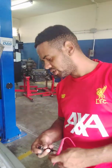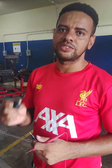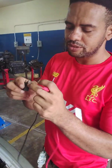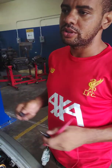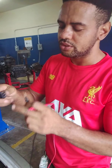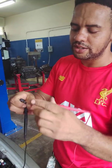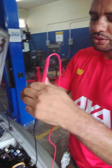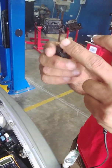All right. So now, this relay that I have in my hand, it is de-energized, meaning that the switch for pin 30 and 87 is not activated. With the switch not activated, when you measure the resistance on these 2 larger pins, you should get an infinite resistance reading. If you look at the multimeter, without getting any reading there, infinite reading, this is telling us that this side of the relay is actually good.